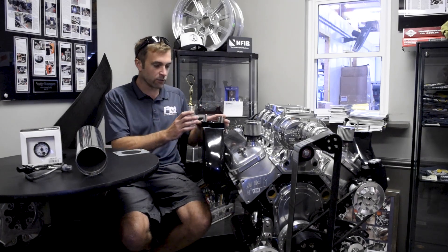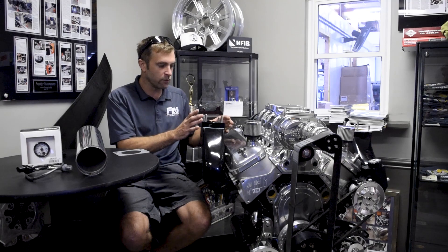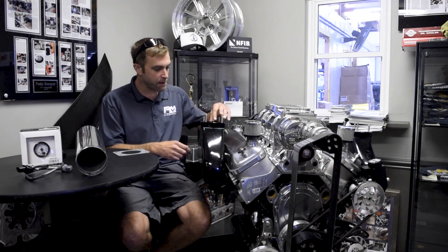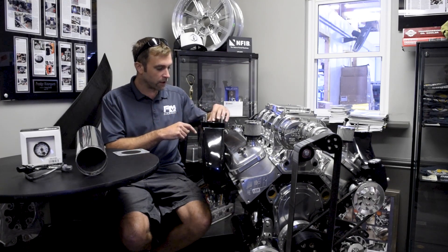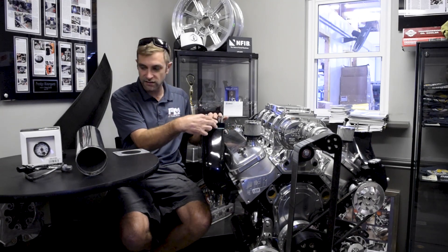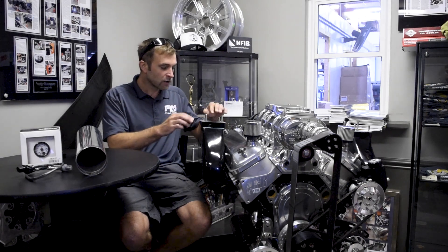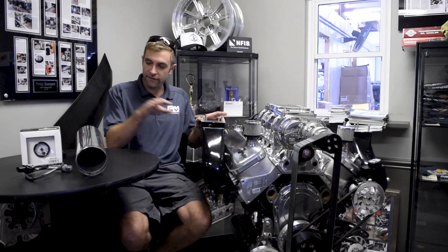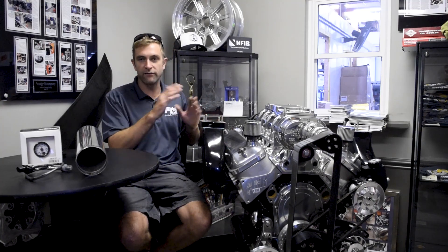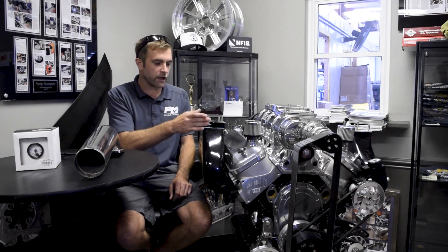There will be instructions hung on this engine when the customer gets it. Because of the orientation, you can see it's got a little bit of slop — the bolt holes are a little bigger. What has to happen, based on where the water passages are, is this will have to be pushed all the way to the rear so we completely seal it. We've got a gasket that we've punched the holes in for the water crossover. Make sure it's slid back, then put the tailpipe on and tighten it down — that ensures proper sealing so we don't have any external water leaks.